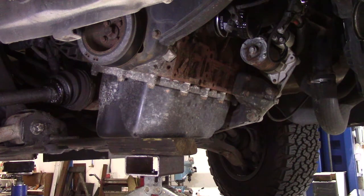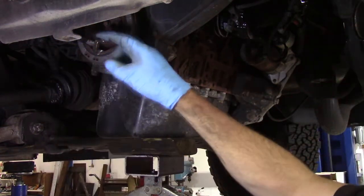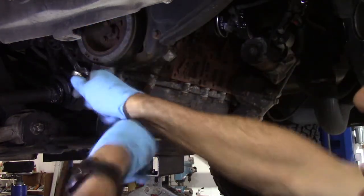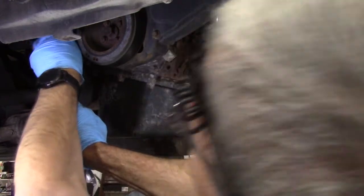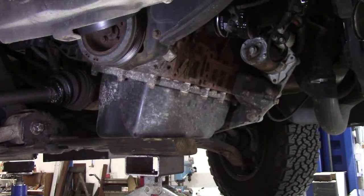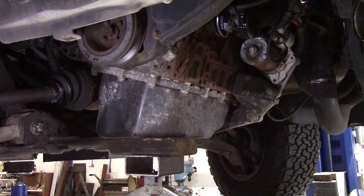So you need a 15mm spanner. Now ideally a long single spanner. Don't try this at home, children. Definitely a case of do as I say, not as I do. To gain the extra leverage, I'm doing the old mechanics trick of hooking that in there. And then this is where you have to be careful, because if this slips, that spring tensioner will hurt when it bites you. So we get that off. That's it. Get the belt off. And you can take the spanner off, and we're safe again. I haven't managed to get a long enough 15mm spanner to do that in one tool.